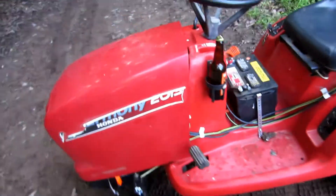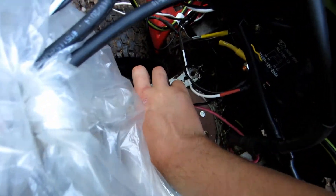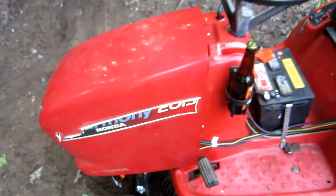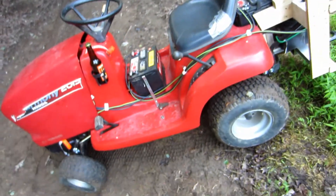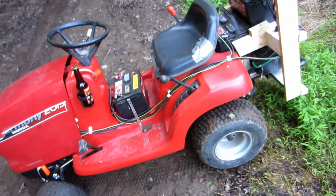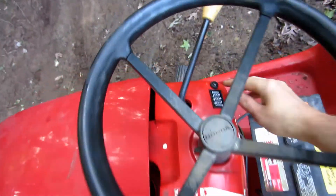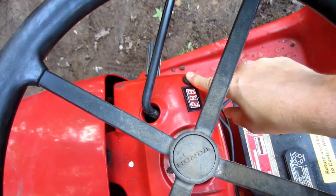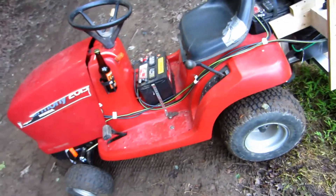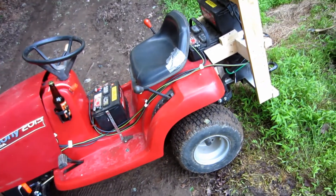Overall, I'm pretty happy with the way this project turned out. Although this motor is definitely underpowered, it's actually okay — it seems to be doing a good amount of work without getting too hot. I imagine my primary purpose of this thing, which is to just drive it around to get from point A to point B with a little bit of equipment, should be satisfied. And certainly the lifespan of the power supply itself is very good — we're at 24.3 volts after beating this thing up for a while. I think this turned out pretty well. If you enjoyed this video, please like and subscribe. Thanks for watching.